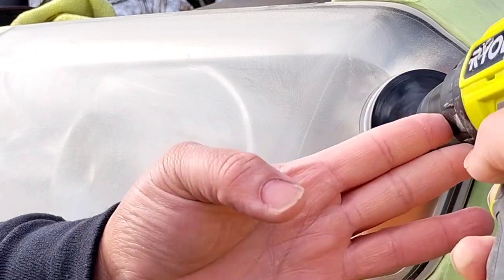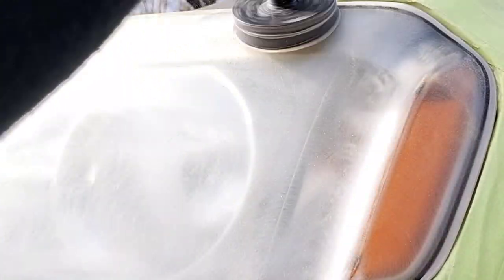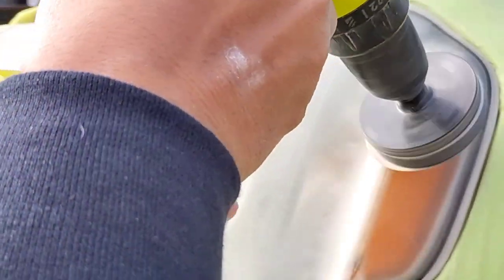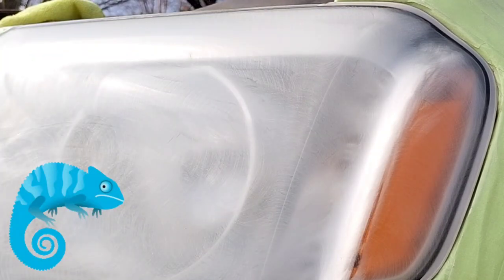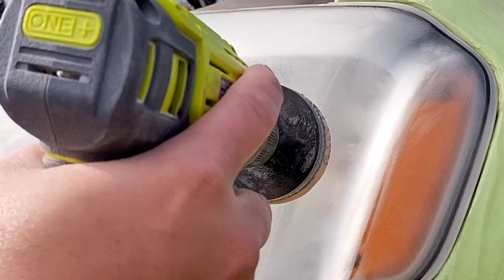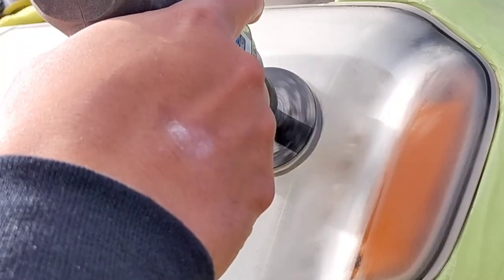Friction causes heat on the surface when you're using any kind of polisher, any kind of material that's moving with a polisher, a DA, orbital polisher, whatever you're using. Okay, you're causing some kind of friction with that light with the polishing agent. So it does kind of a bleaching type thing to the cells of the surface of the polycarbonate. Okay, it's not removing anything really. All right, so what happens with these rings is pretty much that little minuteness that is being removed, okay, plus the polish is kind of gumming up and embedding itself.